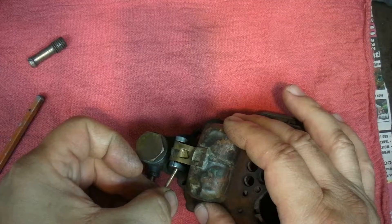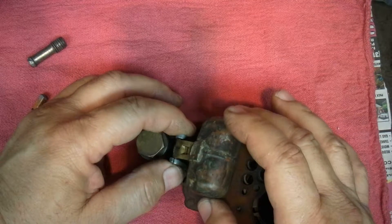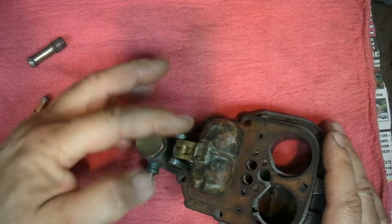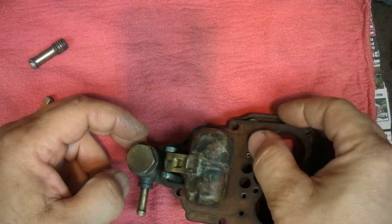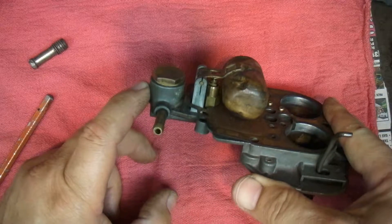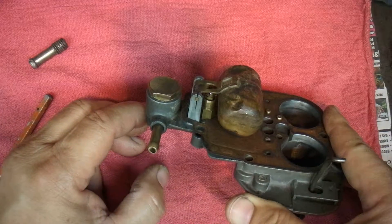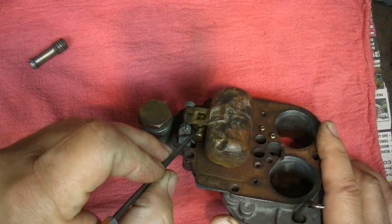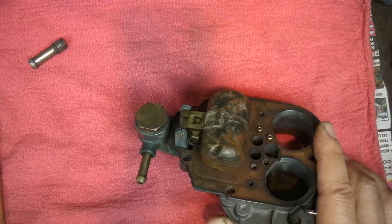Don't pay attention to this float — I just use it as a keeper for the inlet valve, because if you don't have a float there to hold it in, I have this feeling that if you mismatch your needle and your seat, it's not a good idea. After you polish them, maybe it doesn't make much difference. But some needles actually don't match with the seat — meaning it's too big — so there are different size seats and needles.